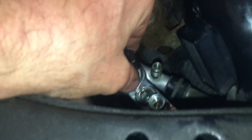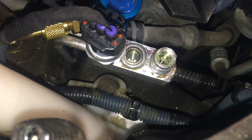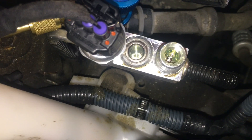I forgot to add my refrigerant oil. I'm also going to add some tracer dye to the system. What I'm going to do is pull the Schrader out of the high side, replace it - I've got some new ones in my kit.